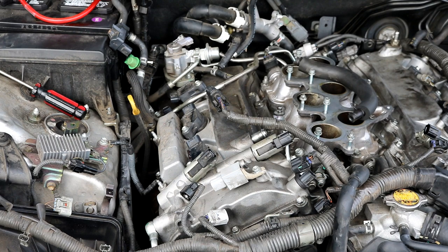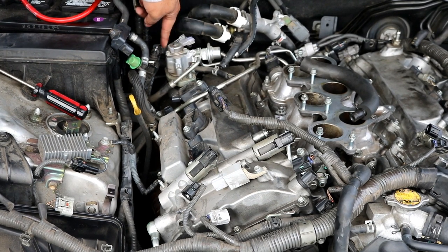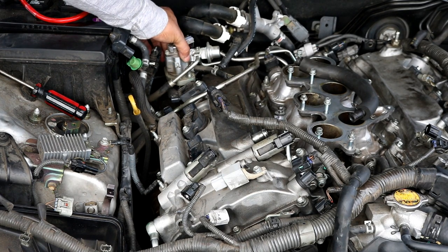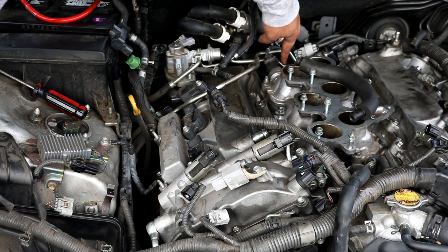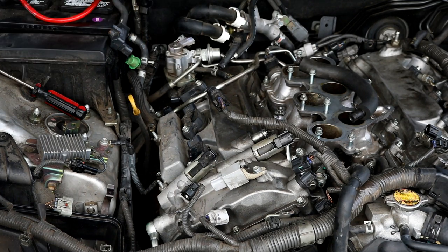what I'm thinking is the fuel pressure regulator. That's this thing here in the back. It's held on by two 12 millimeter nuts, one here and one in the back. In order to actually pull it up, there is this metal line right here that goes back right to the middle behind the intake manifold on the fuel rail. There are two 10 millimeter screws that attach it there, so go ahead and take those off as well.